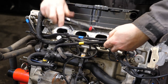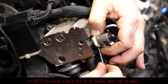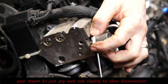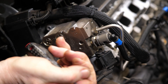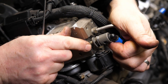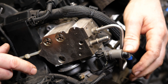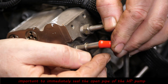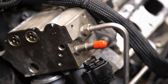We'll just unclip these pipes. You do need to be very careful here — I thought you had to prise this off, but you don't. You've got two wings and you need to just open those wings at the bottom and the fuel pipe will actually come off. If you do what I did, it will obviously break, and then you've got a problem because that's not going to secure back onto the fuel pump. Once the pipe's off, you do need to cap the fuel inlet pipe because if you get anything in there it could be absolutely disastrous.